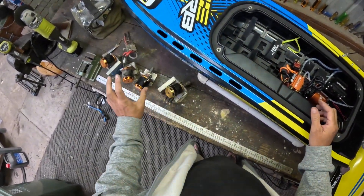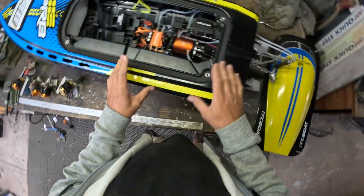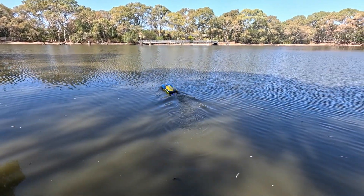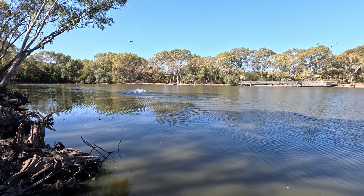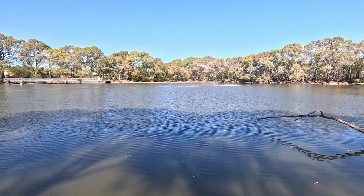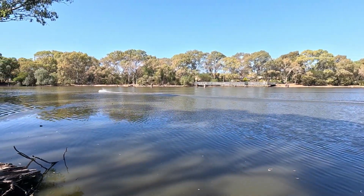I want to try one of these in a boat - I'm actually going to try a couple of them on something pretty special in a couple of weeks, but that's a whole different video. I'll run this today, GPS it, put one of these in there and play around with props. After that I'll put some TP motors in it - just do a baseline test with all the trim tabs and the stinger dead level, leaving everything at the same setting no matter what prop or motor I put on. It's a nice setting for a mix of speed and drivability without having to back off.